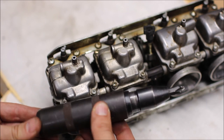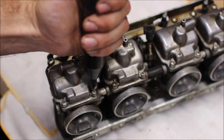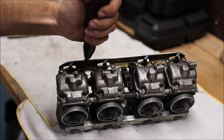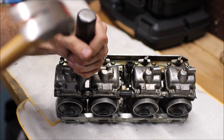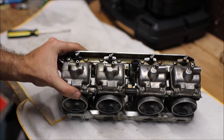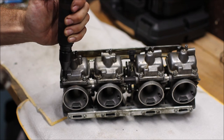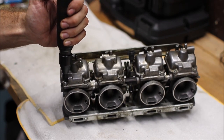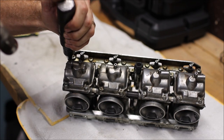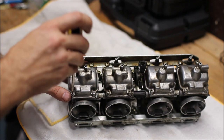What I definitely need to help this process is this impact driver — a manual one, not one with a power drill. These are pretty cheap at a hardware store. We're going to take the impact driver, set it in here into the screw, and just take a hammer and tap it a little bit, and you'll see the screws easily come out. I'll repeat this for all of these. Even screws that look a little bit stripped are coming out easily — this is a worthwhile tool to have. Then you can just take your regular screwdriver and pull these out.